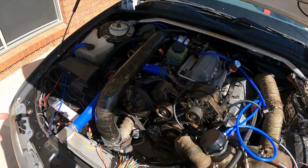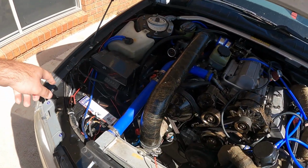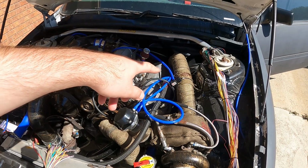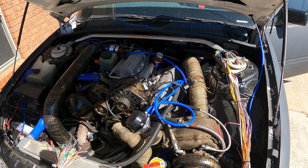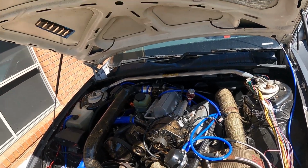Plan. We'll start mapping out where everything's going to go, utilizing our wiring diagram, and then we'll do a temp pre-cut, map out the wires, and add in any wires. For instance, we're going to add in an oil cooler fan, the starter motor, the trigger wire, all that's going to go through into the loom. So yeah, let's get stuck into it.